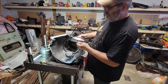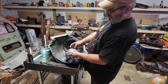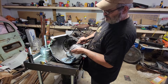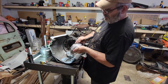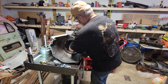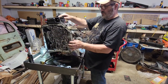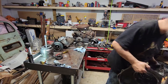A lot of people won't get into this and that's a huge mistake. There's three very important seals right here, here, and there. These things get all hard and brittle and they junk up, and then this piston doesn't move like it's got to. Other than the bushing at the back, everything we got to take out of the case — get this out of the way and go look at getting it cleaned up.